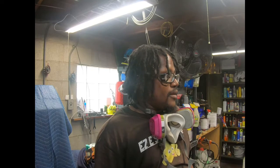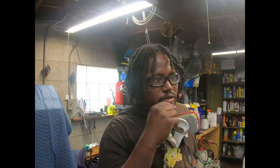So like I say, I'm gonna hit this with some 2K TransStar primer. So that's 4 parts paint, 1 part activator, 1 part hardener. I'm gonna try using that, since after I paint these cars, people like to go scuff them back up or key them or scratch them, and they scratch too easy using my other primers. I'm gonna use a hardened 2K primer instead of 1K.